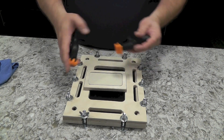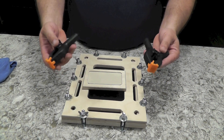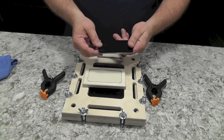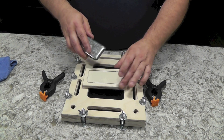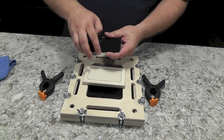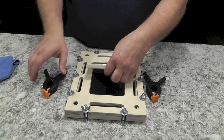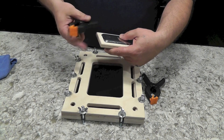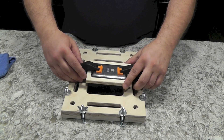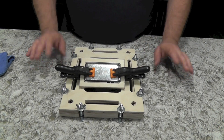It's real simple — you can get two-inch clamps at Home Depot for about two dollars and fifty cents per clamp; these are not included in the kit. Once you get your digitizer set back on your iPod, you'll see a laminate plate that's cut in so that you don't rest on the plastic outer edge. Just put it face down, place a clamp on each side, and let it sit for at least four hours. It's a very simple but effective kit.